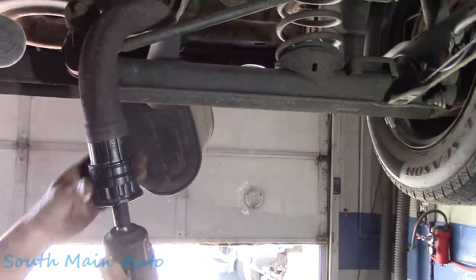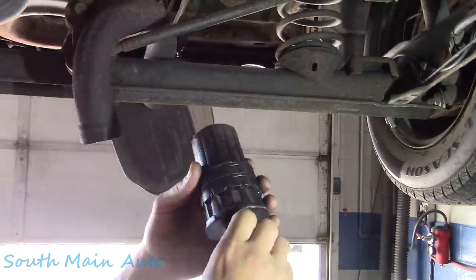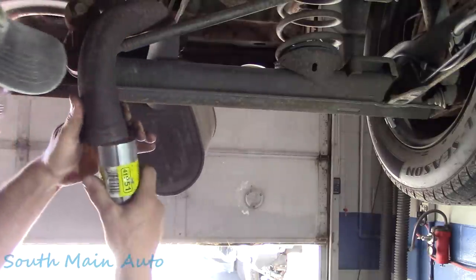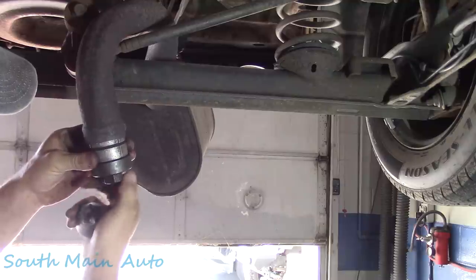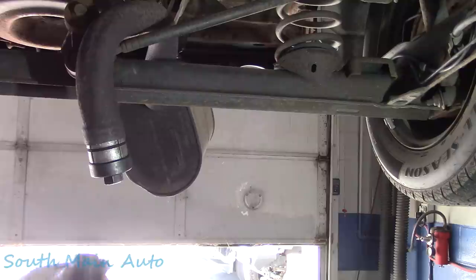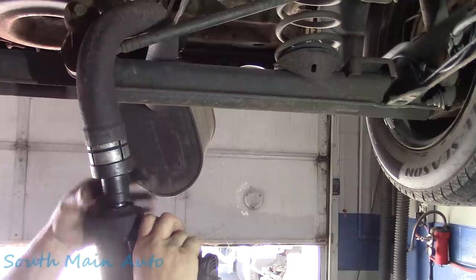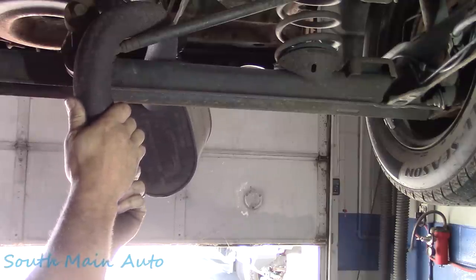We can't get enough beef. Instead of destroying it, this would probably work great for straightening out pipes, you know, when Napa sends them and the ends are all smashed up. Let's grab our other expander — much bigger forcing screw on this one. We don't have to go a lot more anyway. If I don't want to split the pipe — this old rusty pipe splits pretty easy. If it does, we'll just have to put a little weld on it.